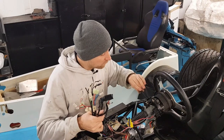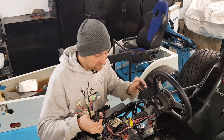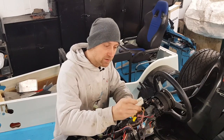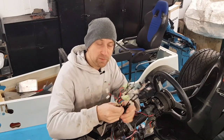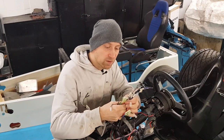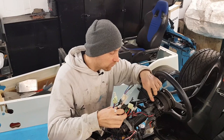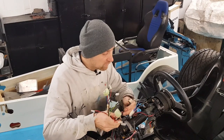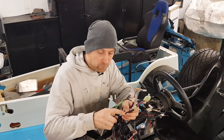We've got indicators this side, lights on this side, and also main and dip flash. We have got wipers on this side but as we've not got a windscreen we're not going to need them. It did come with a bit of GBS loom - the Sierra plugs this end and they all go to this multi-plug. The Tiger loom is slightly different because it looks like they didn't use Sierra light switches - it's got the plugs for the old-style rocker switches. The Sierra column has got a hazard switch on the top but I'm not going to be using that. I'm going to be using the nice posh savage ones we've got to go with the horn button. These are all labelled much the same as the front - we've got ignition, dip switch, horn and indicators, light switch, hazard switch, and rear fog switch.